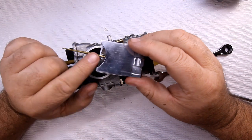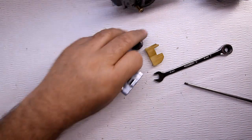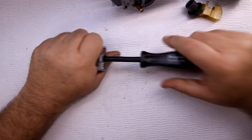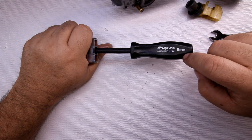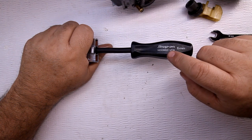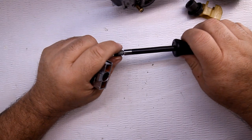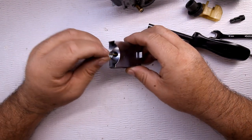This buildup is more likely two-stroke oil residue. Let me go over this needle and explain how to adjust the needle depth. You take out a little screw and pull out the needle. The needle — if you're running a little rich or a little lean at full throttle — you adjust the needle depth inside the main jet.